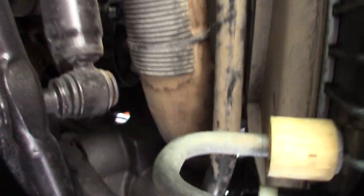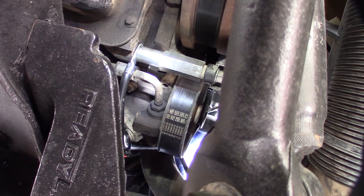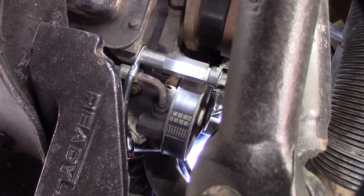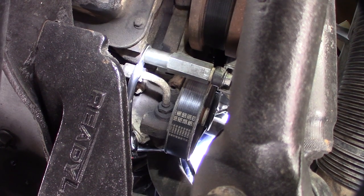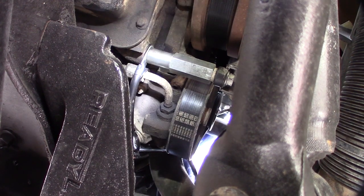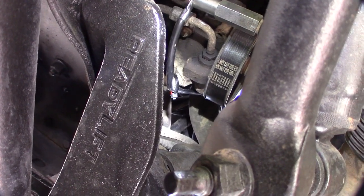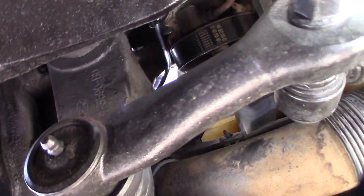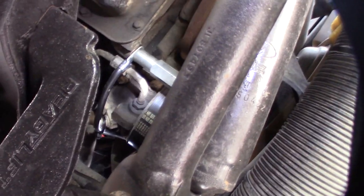I got this thing done. I took that little bracket piece off and put the ground strap on. I used a wire wheel to clean up all the surfaces. It throws that plastic thing out of alignment by maybe a millimeter — once it's crushed down probably half to three-quarters of a millimeter. I also put a zip tie right there so in case the thing got out of position, there's no way it would fall forward and get caught in my belts, even if I was off-roading.